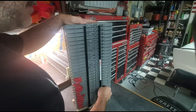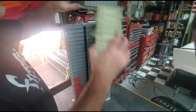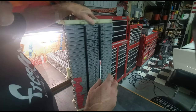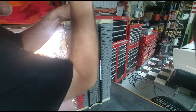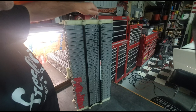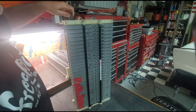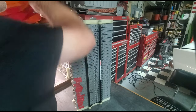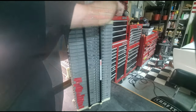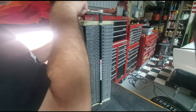Now you can see they're all lined up in the same direction — all these vent tubes are on the same side. We're going to put our end cap back on for now. When tightening these up, you don't want to go all the way down on one screw — you want to work your way around so it pulls everything down evenly. You don't want to put too much stress on one part of the battery. I'm not really torquing these down at all, just until they stop.